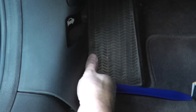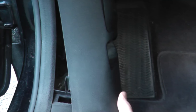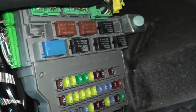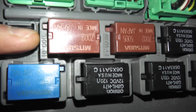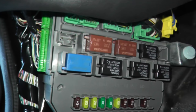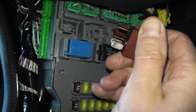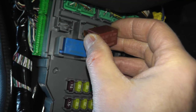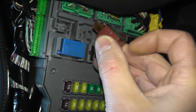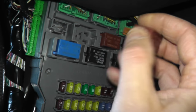Sometimes you don't even need them, which we don't in this case. Here you go — this is where the relay lives. Right here it says 'ignition coil,' so this is the relay we need to deal with. We'll remove it and I'll show you how to test one of these. If it's really tight and you can't remove it, you could use a pair of pliers — just wrap the end with some electrical tape so you don't damage the body of the relay.